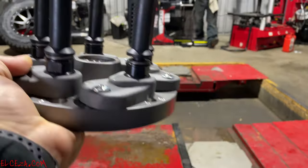There's a little micro switch inside here. Same as on the other one. It's got a little tang on it. It's about as long as my finger. It's less than a quarter of an inch wide and right over a millimeter thick. And it sits right inside the rod and runs up here. And when you go and step on it every time, it bounces it around, and eventually, the little plastic micro switch that is this long and that thick that has two little buttons on it that tang is contacting to make a beep noise, you bend it or break it or maim it or do something to it, and then I get to come out and fix it.